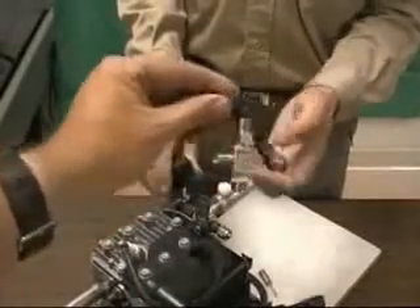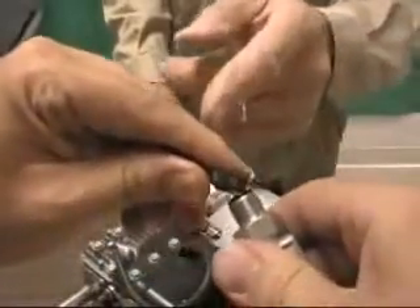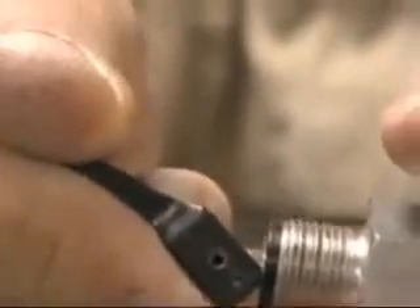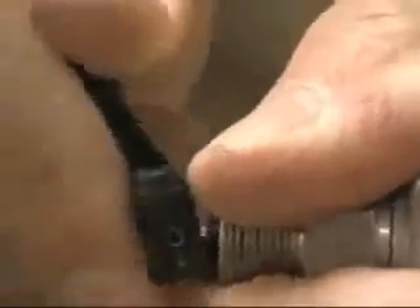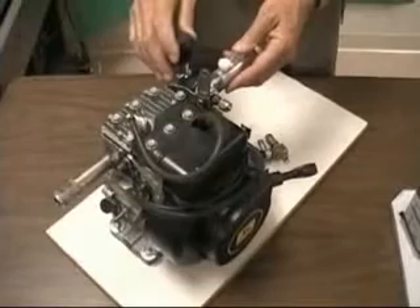You're going to control this right here with your foot? That's right — you just put that through a cable. You'll notice this one's equipped with a stop pin. When the pin's in place, you can't take it to full open — you take it to almost full open, but it always comes back. That makes a very handy way to put a lever to your foot feed position; the foot feed will still have mechanical advantage, and that turns out to be about the right tension. You can run it with a single valve or with two valves as just discussed, and still be under $25 in conversion.